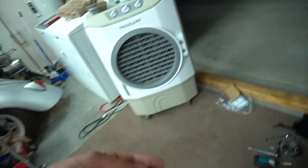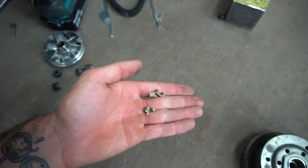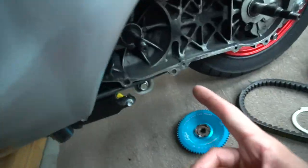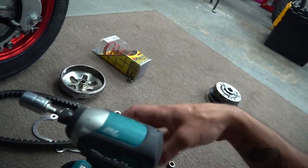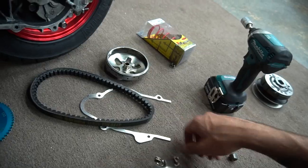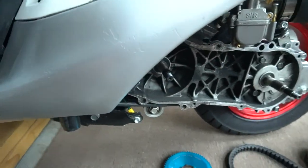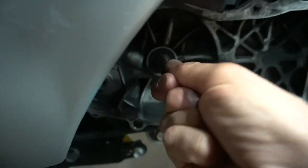I think I found part of my problem - these are like the variator plate slider things, and look - I put the stroker back together missing a whole half, and it wasn't in the case at all. That's crazy. I felt it happen too, because right after I rode it and hopped on, I was like 'what the hell' - it was taking off super bad and not kicking in like it should. I'll get some new ones, but that puts this on hold. I'll go ahead and throw the clutch in with the new center spring while I have it all apart.